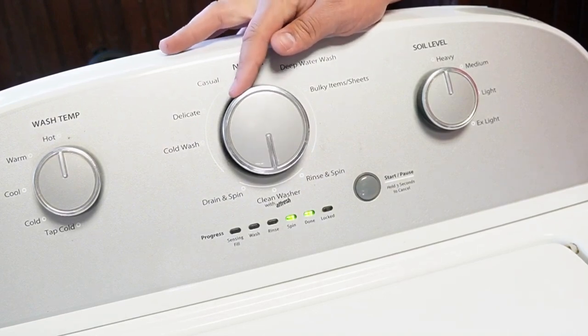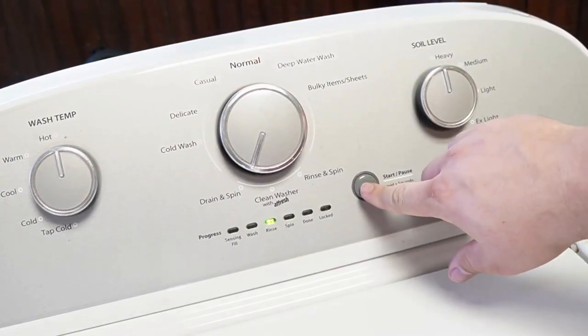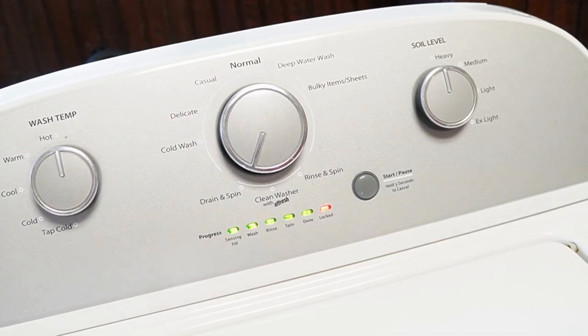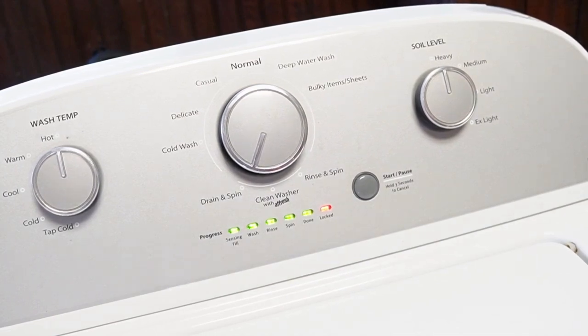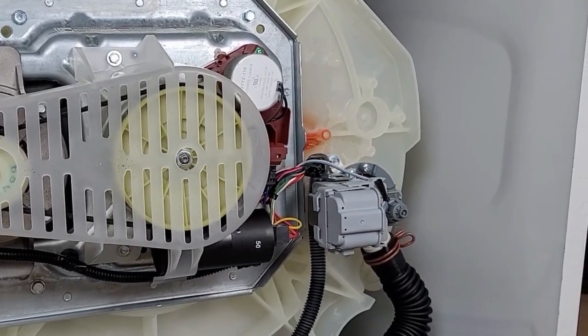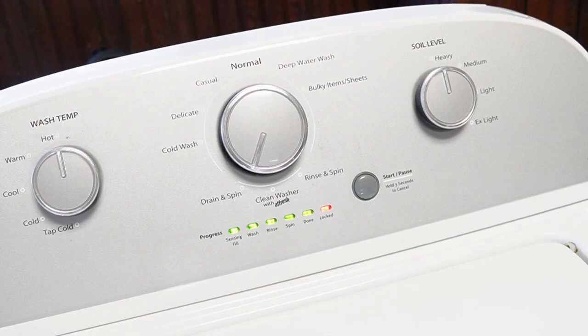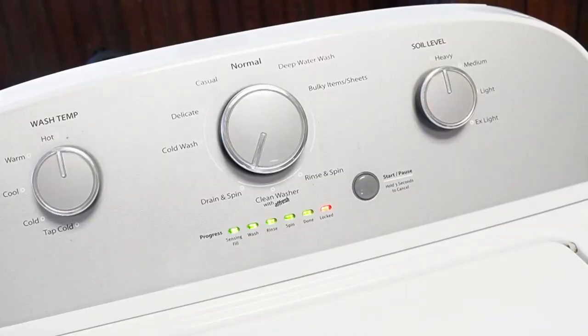Once you're in this mode, turn the knob clockwise four times. The rinse light should be the only one illuminated solidly by itself — this is the recalibration mode. Once you press the start button on the rinse mode, the door lid will lock and it will begin a series of tests and operations on your washing machine. All these tests take approximately three minutes. As the recalibration mode runs, every part and process is going to be run, and the machine will physically reset all the components to a default state, allowing them to run at an optimal level. You're going to hear all kinds of noises from the machine, and that's totally normal during the approximate three minutes.